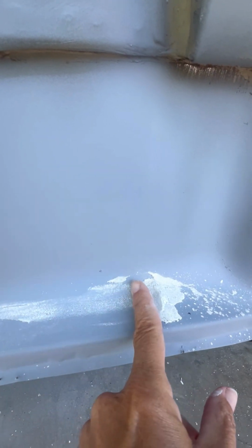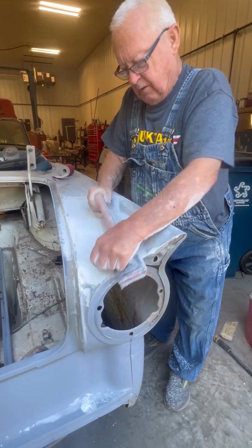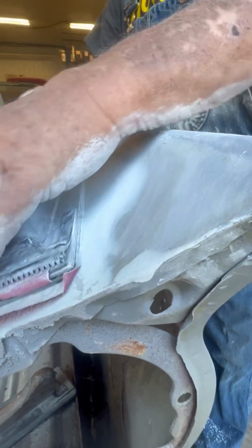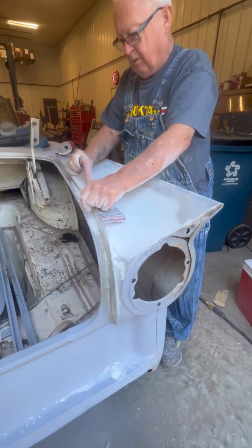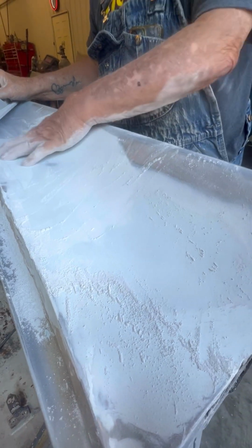See, this right here would have been a treasure. Oh, look at that. We just found a big pile. But, well, there's definitely an art to it. Very little hand sanding. Just about everything you do is with a block, you know. Big block, a little block. The way these fenders roll, this big block is perfect for it. Just got a nice roll on it, you know.